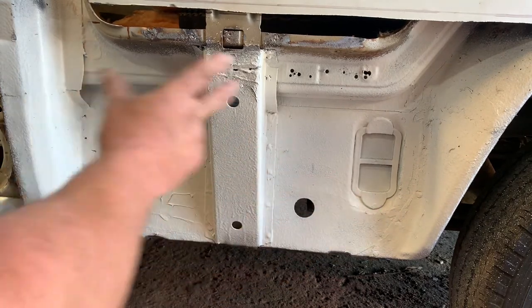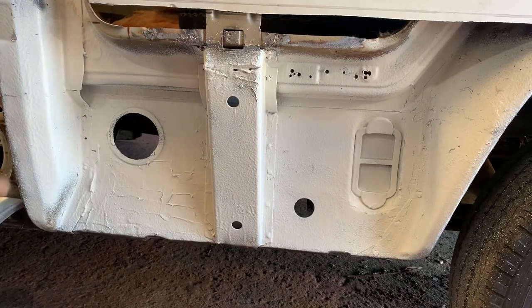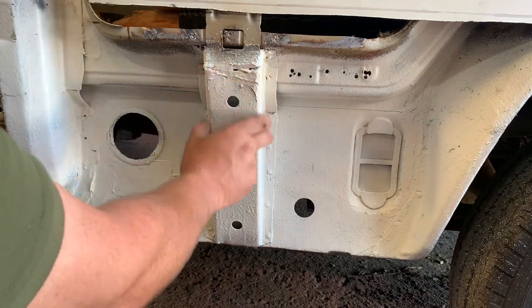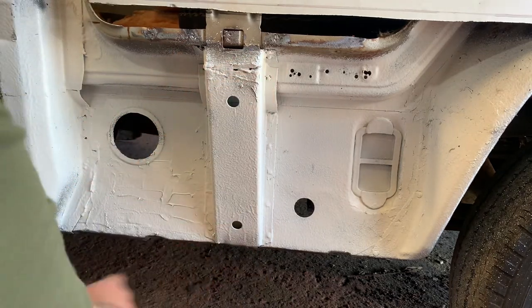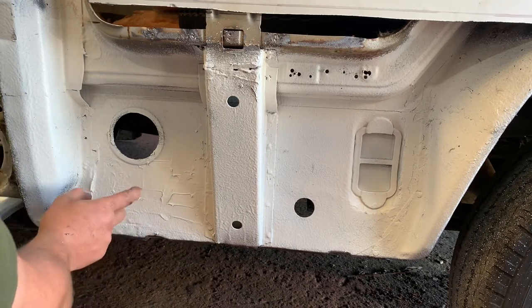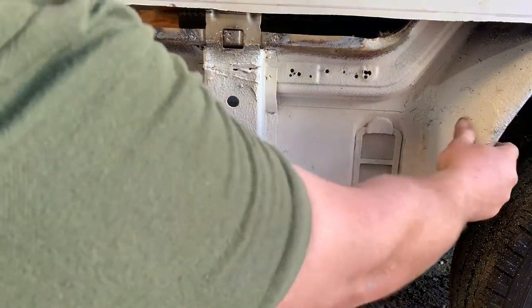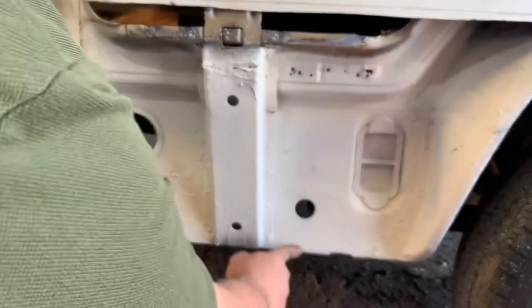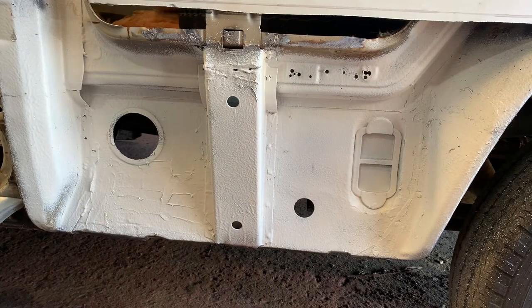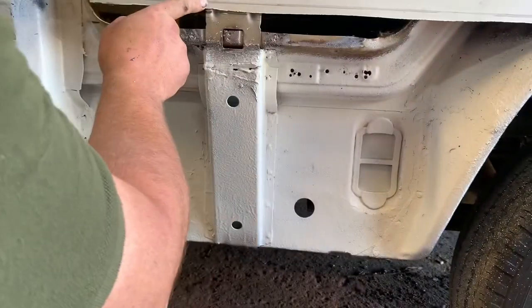because we have a range of dead vehicles, you've just seen me cut a panel out. I've actually replaced this door pillar completely, welded it in, and this support is out of another vehicle. That's good. I've salvaged a good bottom. I did have to repair it here just for a very short way, out of another dead LT. So basically all of this rear wheel arch corner is all seamed in, welded up, undersealed. So what we're going to do now is we're going to need to joggle an edge on here, because obviously we're going to have a panel join.